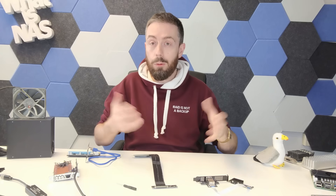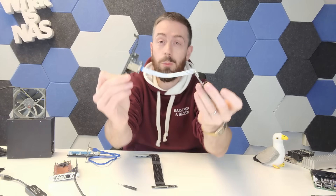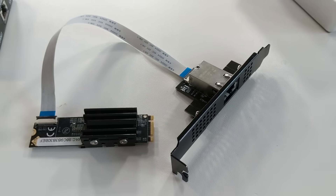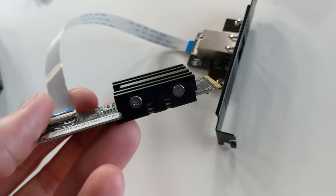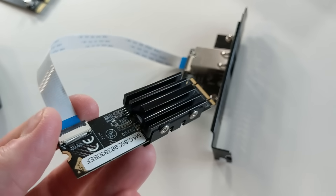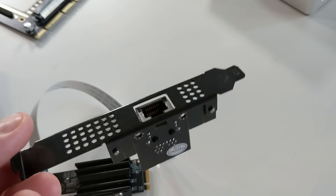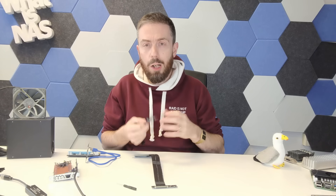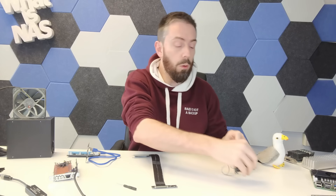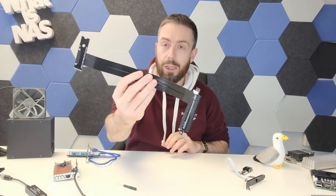With that in mind, let's look at some options we've already talked about on the channel. One of the most interesting in terms of ease of deployment is this: an M.2 to 10GbE adapter utilizing one of your M.2 slots with a ribbon at the other end. Once connected inside your system, you've got a 10G output. Depending on the M.2 slot's gen and speed, you may feel you're losing out on bandwidth — and for those wanting to leverage more bandwidth at x2 or x4 speeds, there are options.